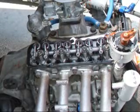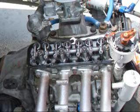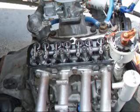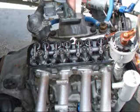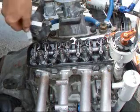This engine has the Joel Engineering 283-degree cam in it, and the valve specifications are 0.010" on the exhaust and 0.008" on the intake. So I have a feeler gauge here with a 10 and an 8, and I'm going to check the exhaust first.